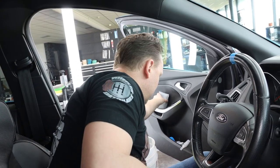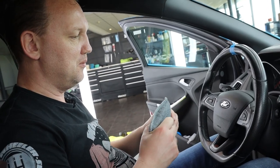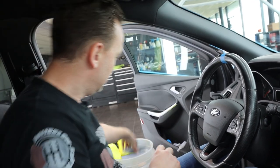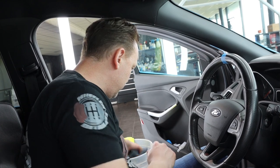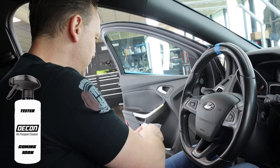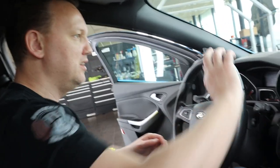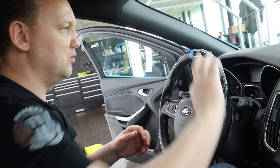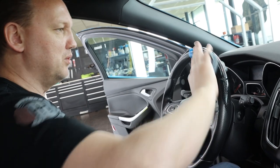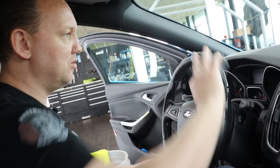The key thing is always to clean, rinse, and dry — that's always the trajectory we follow here. Since this sponge is a little bit harsh and rough, I've decided not to use it on leather. I'm going to use the clean, soft, short-piled side. I'll dip it into my bucket with lukewarm water, rinse it out, and I've got a new all-purpose cleaner — a transparent APC diluted one to five — to test how this would work. As always on Wheeler Detailers: real cars, real products, real results on real dirt.